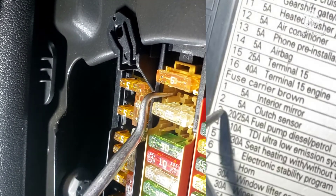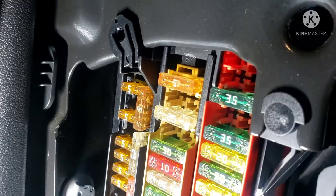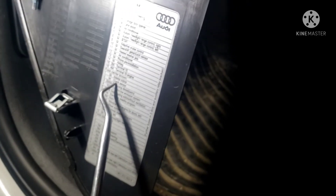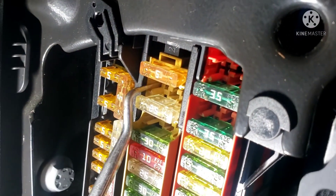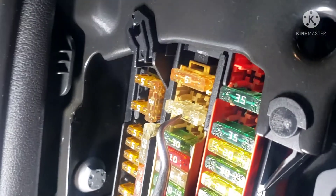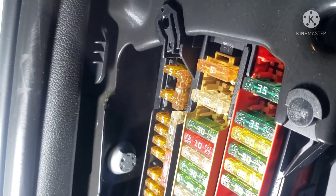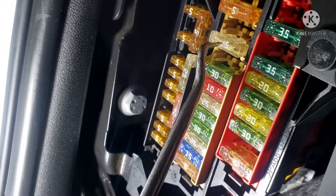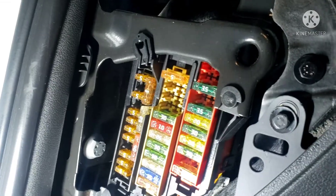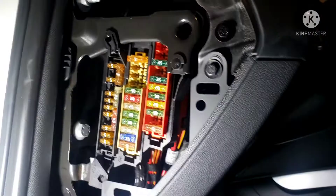One, two - the empty one is two, and three. This is the clutch sensor slot but this vehicle is automatic so there's no clutch, that's why number two is empty. All right guys, so this is the one right here for the fuel pump module slash fuel pump. To disable the fuel pump, pull that out like this and put it to the side - that should disable the pump.